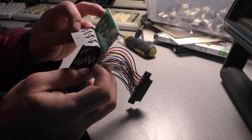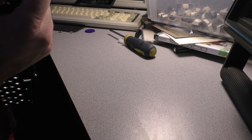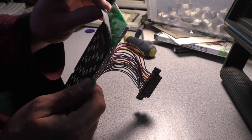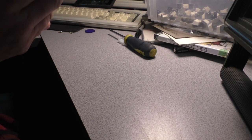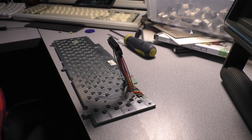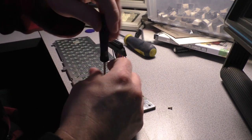This membrane, I do believe, is conductive. And that's where this conduction bar is. This right here is keeping pressure, or compression, against the conductive points of this membrane. Yeah, right there. Do I see corrosion? I think I do. We're going to have to do a little more surgery, and remove that little compression bar very gingerly. I think I see a little corrosion in there.